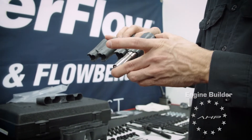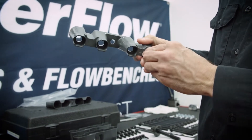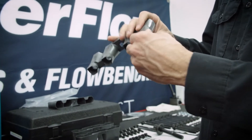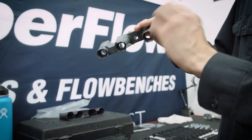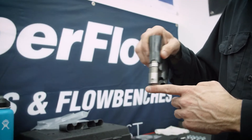What that is — that's at the top right now, it's as high as it goes. That lifter is going to slide in and out of that, but what's happening is it's preventing that lifter from spinning around in there. So that lobe there is able to ride on the cam lobe at all times.